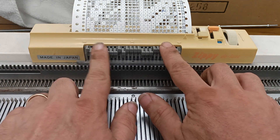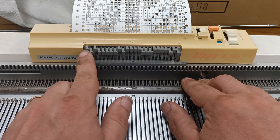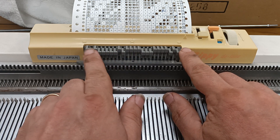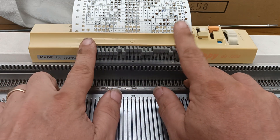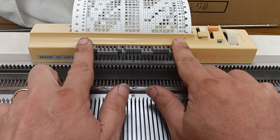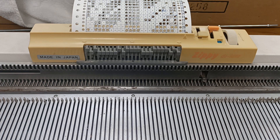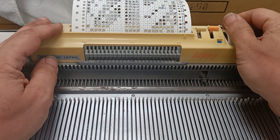Now, if I divide this up into what they call bytes of 8, then I would have one number stored over these eight, a second number stored over these eight, and a third number stored over these eight. And what I could do is use the outer two 8-bit bytes to store two numbers, and the middle one could have some form of instruction — maybe multiply them together, or raise one to the power of the other. But if you're going to do that, what you need is a program to tell you what to do.